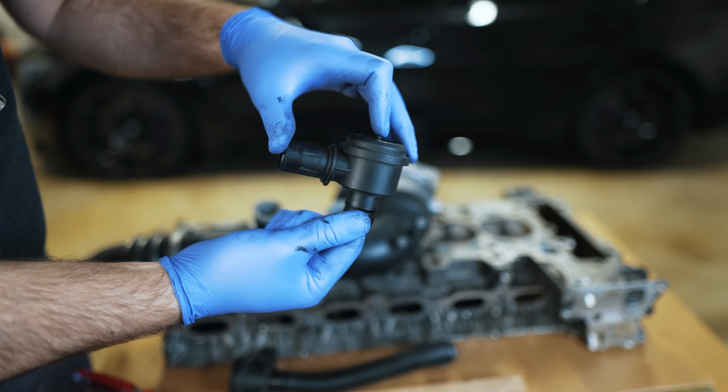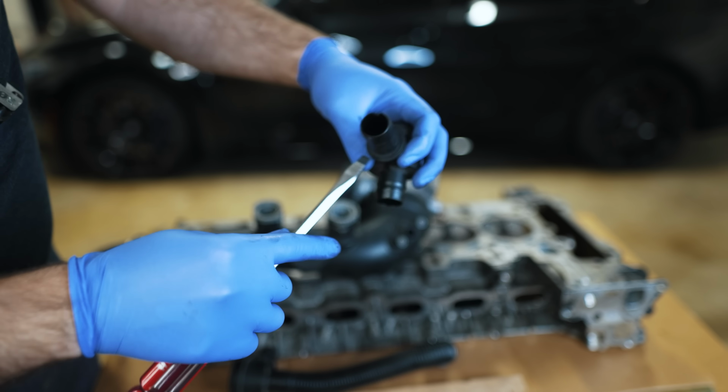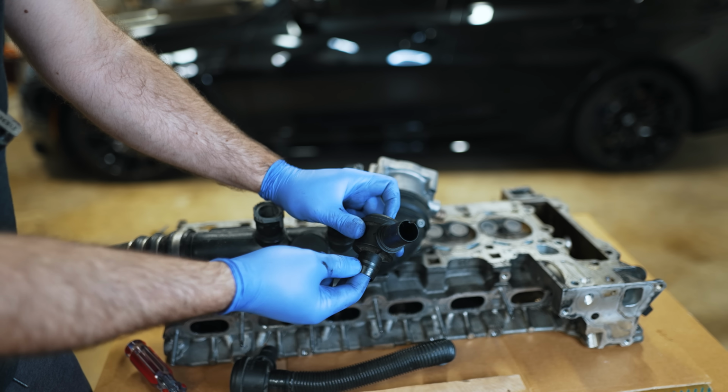So you let off the throttle, the intake manifold goes into a situation where there's less boost, then there's going to be less pressure acting on this diaphragm and it's going to allow for this to push in, and then that's going to allow for this valve to push air back out through here. So as long as you have the same pressure coming into this nipple here as you do into the base here, nothing will happen with this valve.